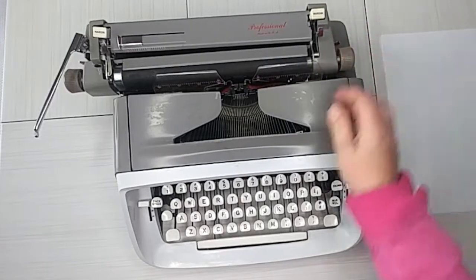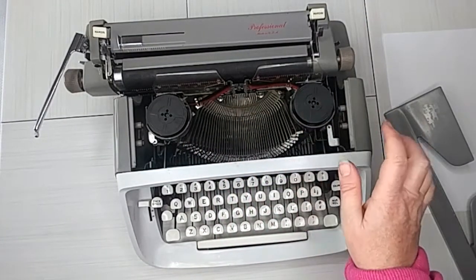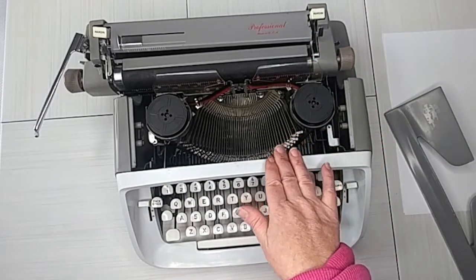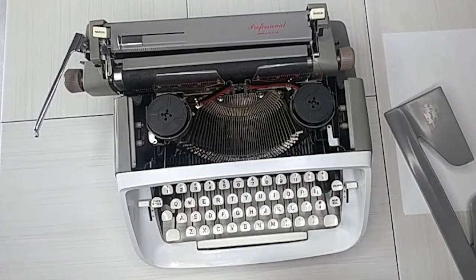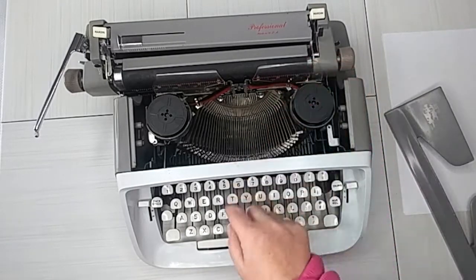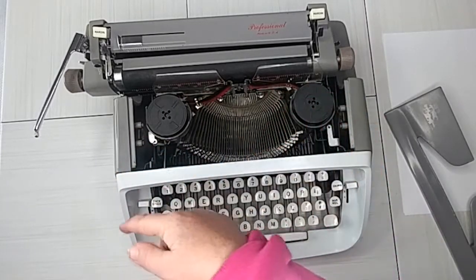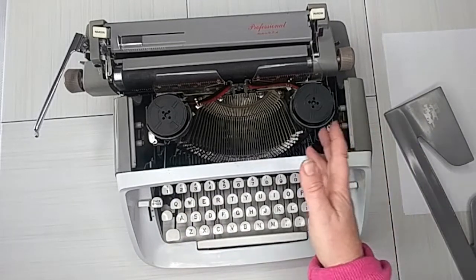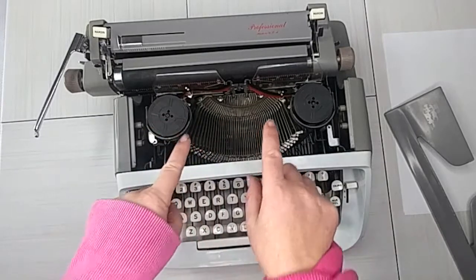I'm going to move this over to the left, pop open the top, and inside you'll see the ribbon. And we've installed a new universal ribbon, black on top, red on bottom. Please refer to the images at the link below so you can see how to thread it when it is time to change out your ribbon. Make sure you thread it through these double bars, and those happen to also be your ribbon reversal, because when you get to the end of the ribbon, which is pretty short, it does not mean you need to change your ribbon. It means you need to reverse the direction of that ribbon spool because there is lots and lots of ink in this ribbon.